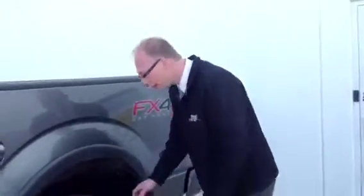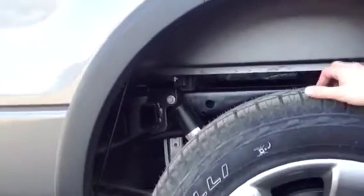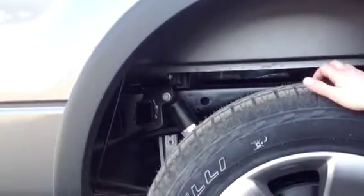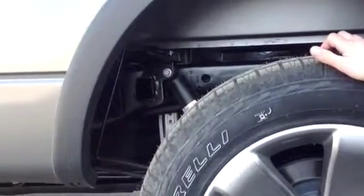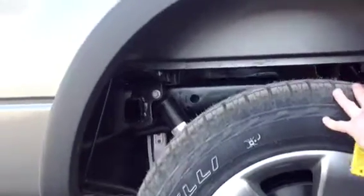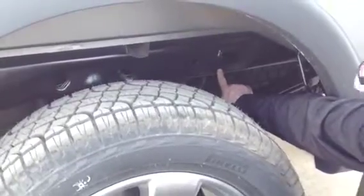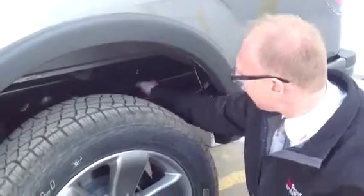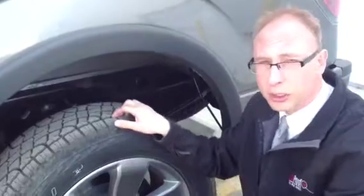If you want to come down underneath here, some great features with the F-150 is we can have the outboard mounted shocks, so a little wider stance, you know, better for those washboard style roads, especially here in Alberta, gravel roads, more stable, kind of like a football player. But again, you can see the frames here, and if I can point out in the back here, it's a fully boxed frame, not an open-ended C-channel. It reduces the noise, vibration, gives you better strength. And then when they weld through, not just attached to the side. So again, that reduces the torsion, the twisting, gives you better strength that way.